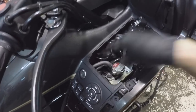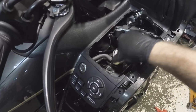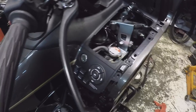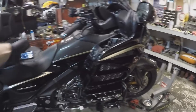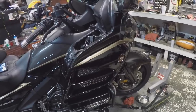Reinstall your radiator cap. I like to keep it so the numbers are readable when I turn it and lock it in. So I install it so when I tighten it down everything reads legibly — lock it down so you can read everything. Start the bike, go for a quick run, go for a quick ride. You can leave this cover off, you can even leave that bottom cowl off — it's no big deal. Take it around the block, get it warmed up to operating temperature, shut it back off, let it cool down completely, and then recheck. One other thing you can do is obviously drain the rear reservoir and add new coolant to that. There are two bars — you can get it right in between there. That's really it, man. It's not too intensive.